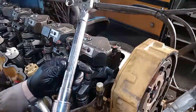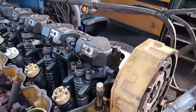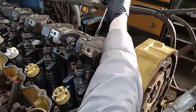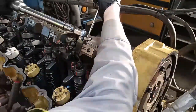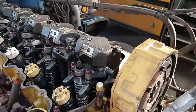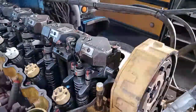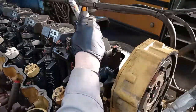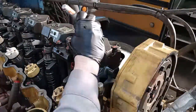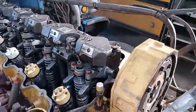The jake torques to 25 foot-pounds — not 22 — and it uses a 5/8 socket, not a 9/16. Torque it at 25 foot-pounds. If you were using a wrench, do you think you'd stop at exactly 25 foot-pounds? Jakes get over-torqued all the time, which can damage the threads on the adjuster, nut, or housing. It's better to torque them correctly initially and skip the step of re-torquing.